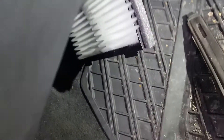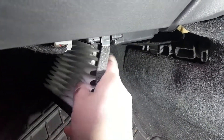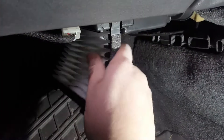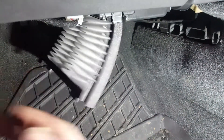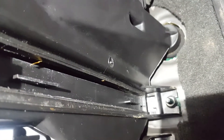Those grooves are so you can bend the filter to get it up round in — you haven't actually got the clearance with the slope of the footwell. So you need to curve it and give it a wiggle to get it up into the housing. It will go eventually, but it's a bit of a fiddly job because you're sort of upside down in a footwell. You can give it a bit of a curve to get it up in there.